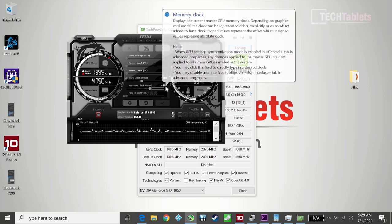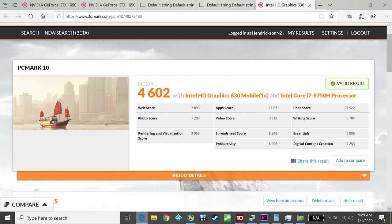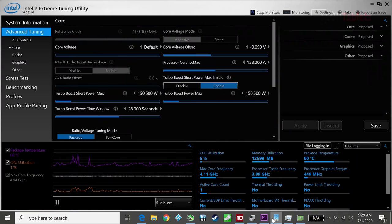The core clock boost barely raises temperatures — maybe one degree — so I recommend going ahead and overclocking, and also undervolting the CPU for maximum performance. I've undervolted by 0.090V. I also tested increasing the power limit and while you can hit thermal throttling, more on that later. The stock power limit is normally 45 watts.